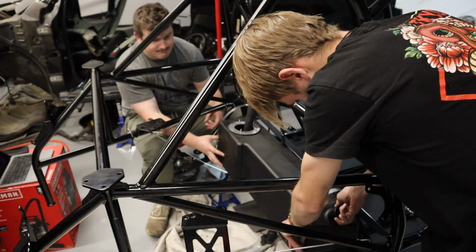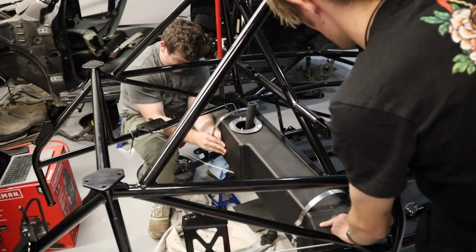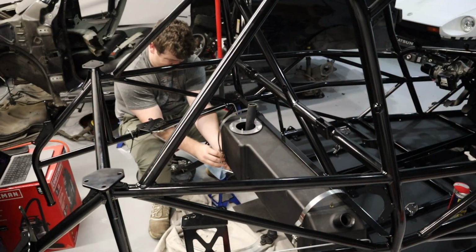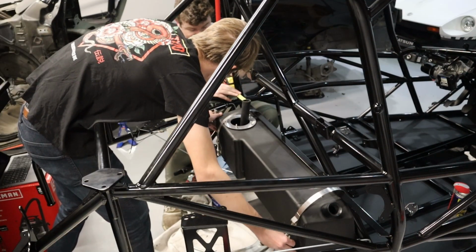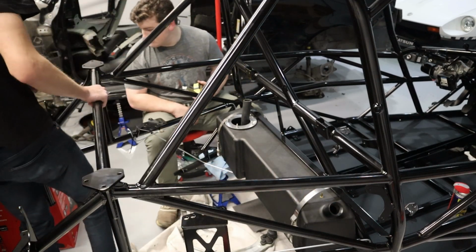Let's do it. Slide the driver's side T-bolt clamp over the fuel tank. Oh, okay, so do this side, then you slide that over. Okay. Then you just stock it out. Move the tank so that your driver's side is 6.5 inches from the end of the mount rail. I think that is there. I think that's as far as I can go over here. That doesn't make sense.